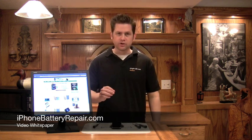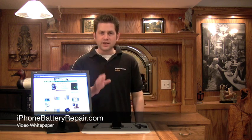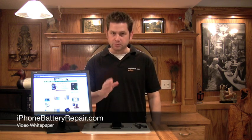The battery connector tabs on the system board are really sensitive to lifting. This is presumably why Apple has a thin layer of glue protecting them. If any of the connectors lift up during the replacement process, you'll require a new system board. Do not pull up on any of the battery wires connected to the system board.